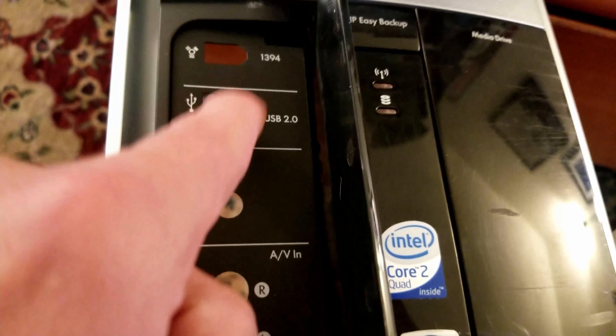Here are our drives. On top we have a traditional SATA DVD drive with a SATA connection in the back. That's the LightScribe DVD drive, and this is the HD DVD drive. I was surprised — this HD DVD drive is using an IDE connector, pre-installed by HP from the factory with an IDE-to-SATA converter. I didn't even know they made HD DVD drives in the IDE form. The IDE bus tops out at about 100 megabytes per second, but it works. It does add complexity because you also need a floppy power connector to power this little board to get the SATA.